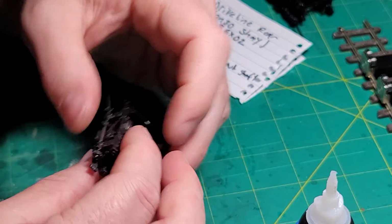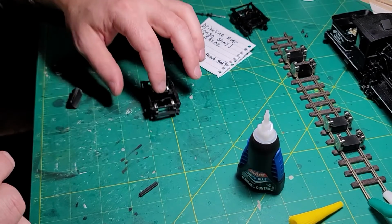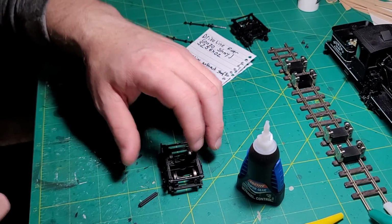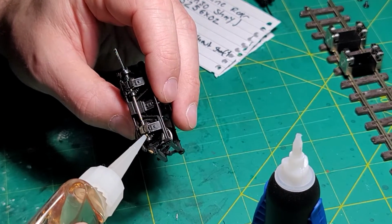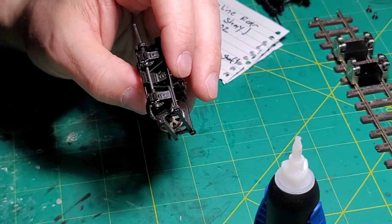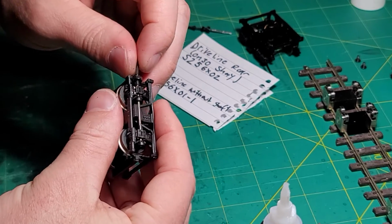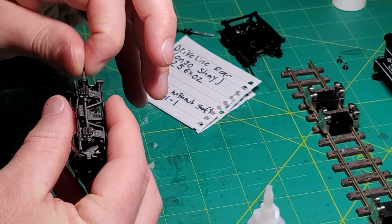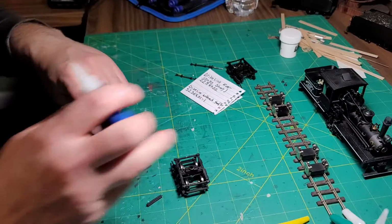A little bit of resistance on the front wheel. Make sure when it rolls, there's no hiccups, no grinding. You can see this one is a little bit tighter, but it's still good. As long as when it rolls, you're not feeling any hiccups or grinding or anything like that. So I'm happy with that one. The dot of oil, not glue, don't put glue. Oil. A little bit of oil there, a little bit of oil there. And give it a good spin. You can put a little bit of resistance on both wheels and make sure that they still both spin and the gear isn't slipping on the bevel gears. The slack is good. And then, yeah, happy with that. So that's how you put new gears on.